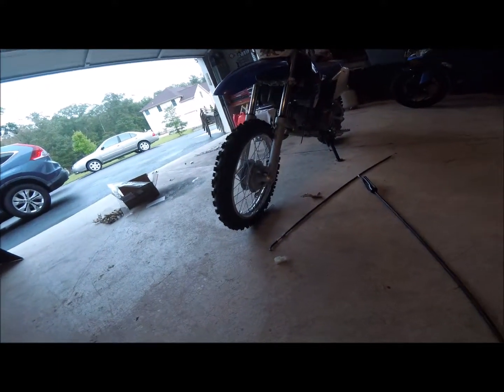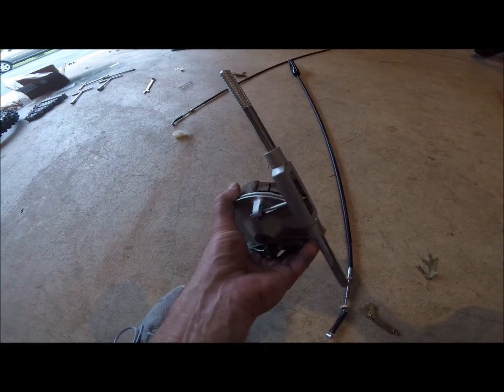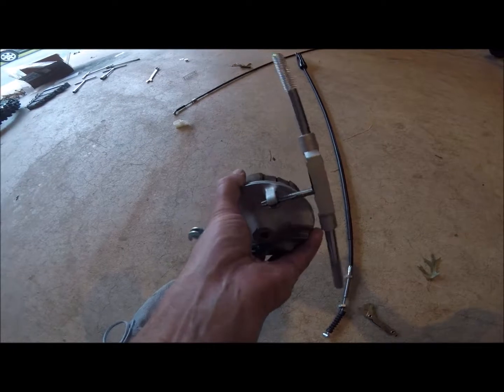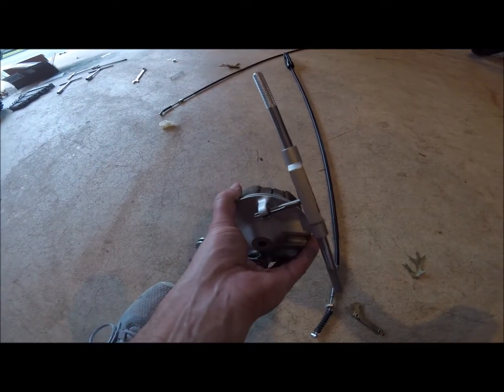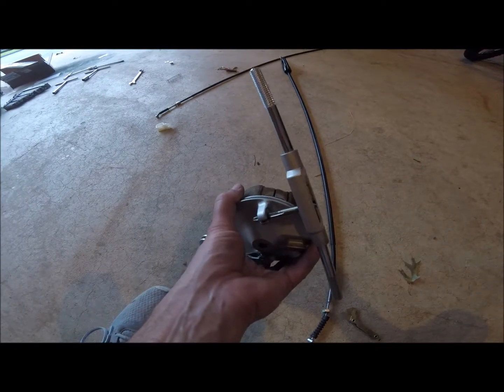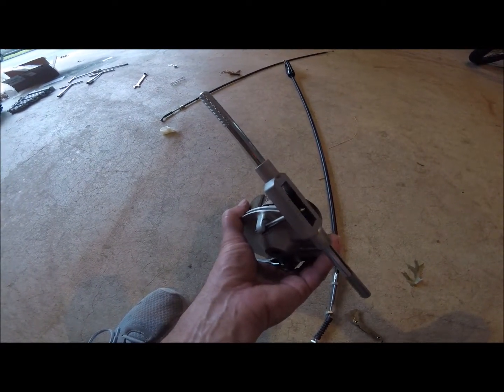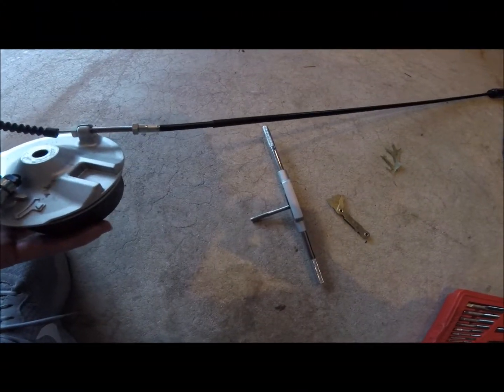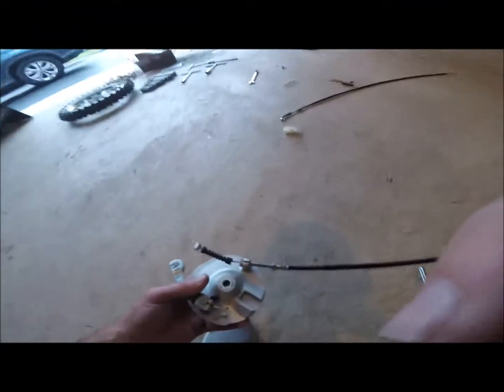We're gonna have to put it on the stand, take that wheel off. Might have to drill it out a little bit bigger first to get that tap in there. But so with a 6mm. And this stuff cuts pretty easy. I don't know if it's magnesium, so I get a feeling this is going to be too small, but we'll work our way up since it's so easy to cut these new threads with this light material. The six was too small. I got the 7 in there now, and she's threading up.